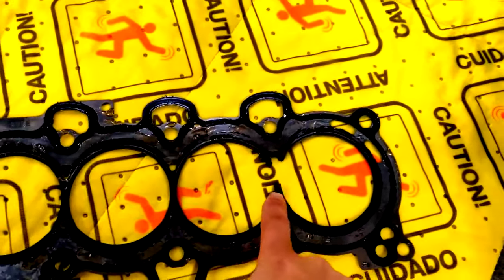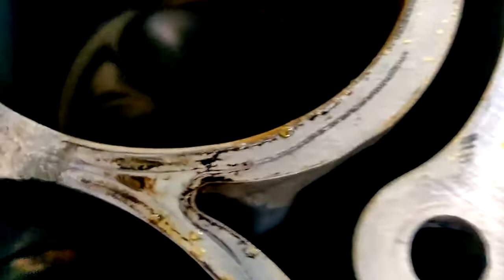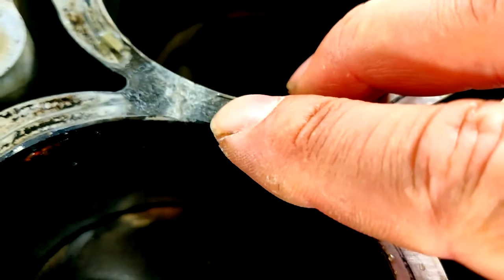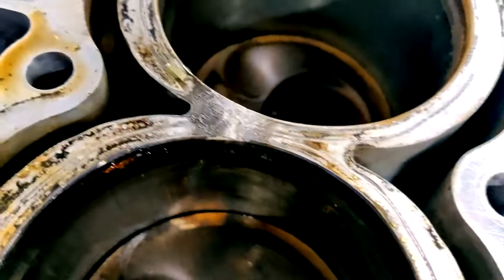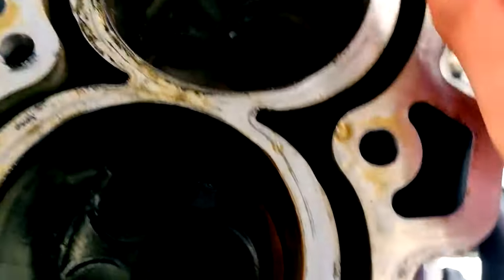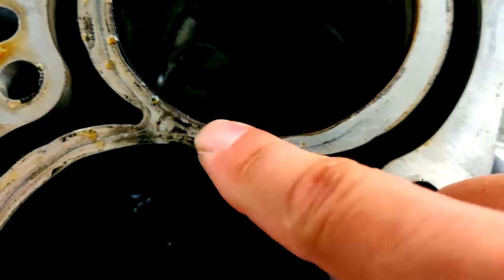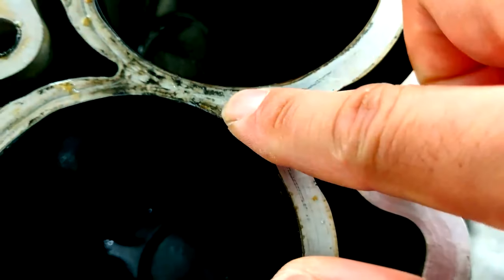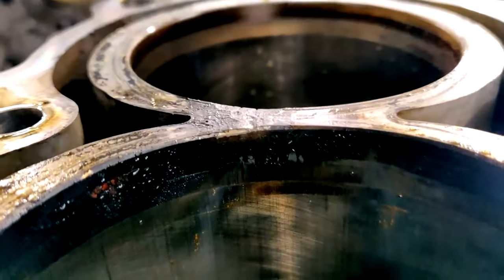I took the head off and there you have it — there's your head gasket problem. If you look at that cylinder, it's corroded — like a deep, deep groove. Probably combustion gases just burned that up. That's where your coolant leak is getting in. Also looking along these, that has definitely been leaking and I can feel a little divot here. Can't see it well on the camera, but that's what it looks like. There's that and then there is that.